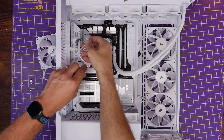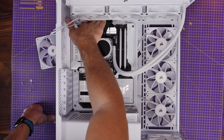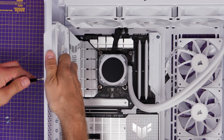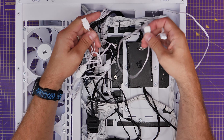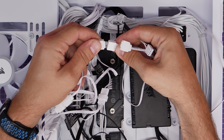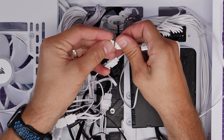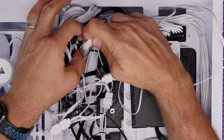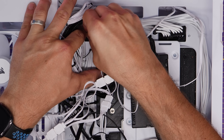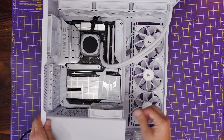For the rear fan, I found there's plenty of space at the back for running cables up through the top. I noted previously that the gap at the top might be too visible, especially if you're side-mounting an all-in-one cooler rather than top-mounting it — those cables will be more easy to see and perhaps an eyesore. The cables at the rear do become a bit chaotic with a lot of RS120 RGB fans plugged in, but you can daisy-chain the connectors. I took the rear fan's RGB connection and connected it to the three side-mounted fans, then connected power from that fan to the motherboard.